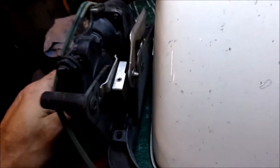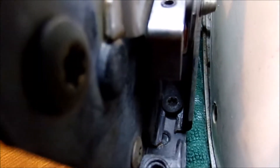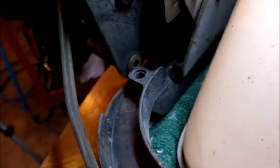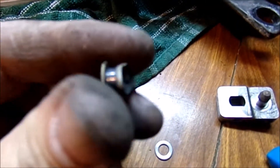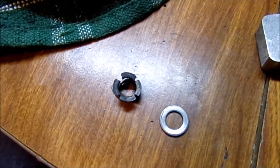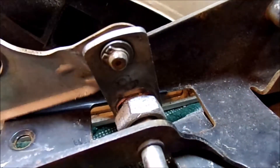Let's move on to number two. A good idea is to take pictures with your cell phone. This hex down in there we'll just loosen — we won't get it all the way out. This one on the back we'll have to loosen all the way so we can get it up high enough to get that bolt out. We've torn a little deeper into this one, and this is my problem — why my passenger side headlight won't stay flush. This bushing is worn. I don't even know where to get one of those. This one on this end needs to be replaced as well.